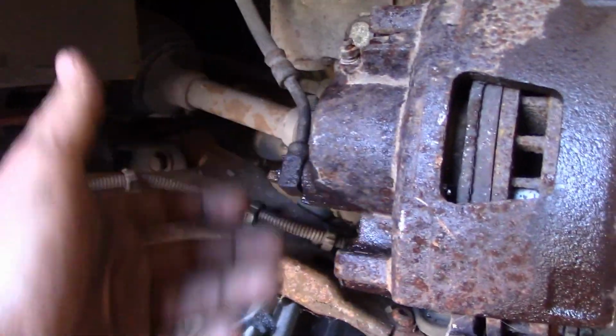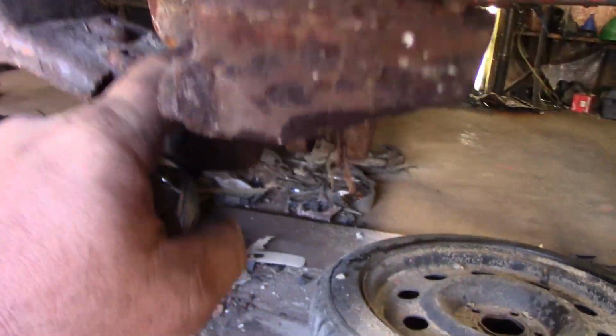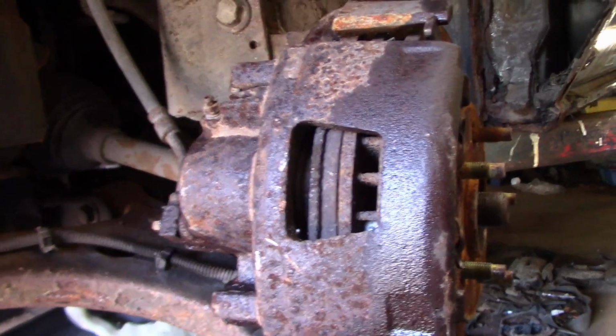We had to switch the brake line from the other one to this caliper because this caliper mounts different because it goes from aluminum to steel spindle. It uses the factory bottom ball joint. It uses basically everything from the actual car. It's actually a very easy swap.